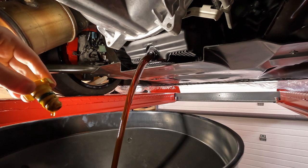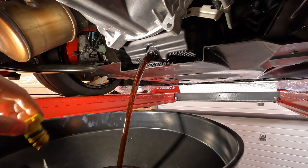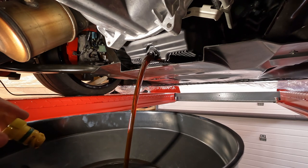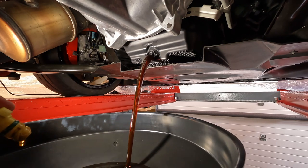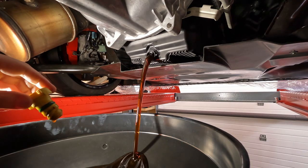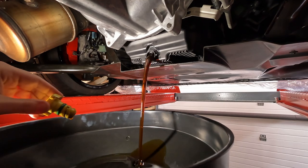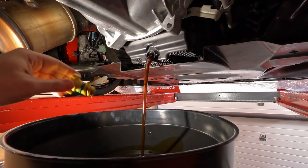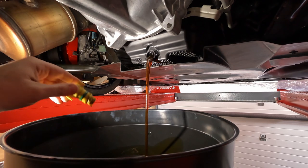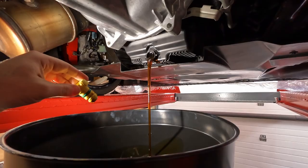Just like that, it came off nicely — I didn't break the ears off of the plug. I know there are aftermarket plugs available for this car, but I don't want to use one. I actually saw a member on my Shelby forum who had a problem on track where his aftermarket plug blew out, and they caught it on film. So I'm going to stick with the factory one for now. I'll go ahead and let this drain — it's going to take a while. The oil is not too dirty, but it's got a lot of time on it, just not a lot of mileage.